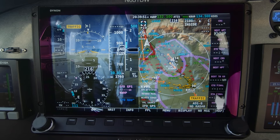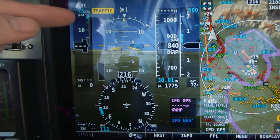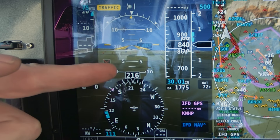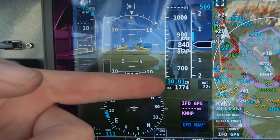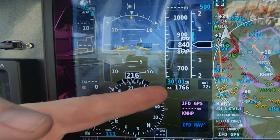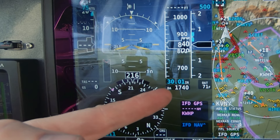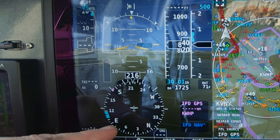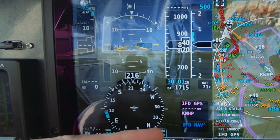You can see the flight instruments here — it's a classic glass cockpit style PFD with tapes. We have an airspeed tape, an artificial horizon attitude indicator with a pitch ladder at 5 and 10 degrees, altitude tape, vertical speed indicator tape, local barometer setting, outside air temperature, and density altitude that's automatically calculated and always displayed — very useful on takeoff. We have an HSI driven by a magnetometer with no precession, so you don't have to reset your DG. We also have ground speed indication and HSI source selection.